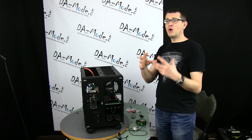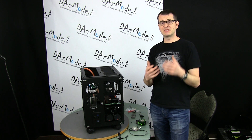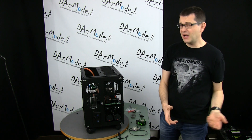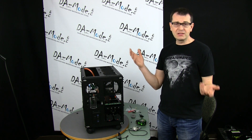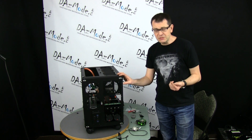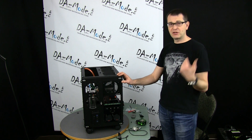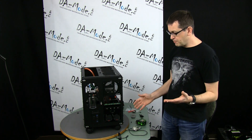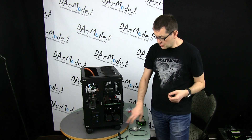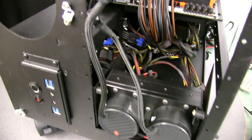I decided to separate the reservoir and pump combo that we originally had in place. The reason is that the way the reservoir-pump combo was assembled, it required the pump to face down with its controls hidden. Since we may want to test results at pump speeds one through five on the D5 Vario unit, I really wanted easy and convenient access to the controls. So I separated the two units and turned the pump so I can access it — facing forward so I can see all the controls right there.